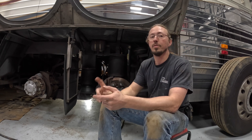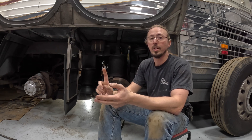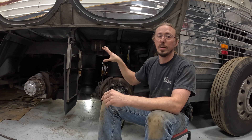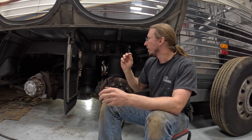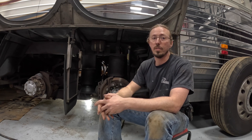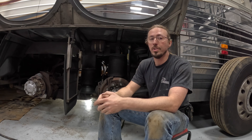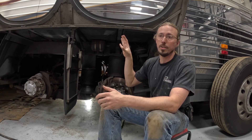You don't want that for a couple of reasons. First, you don't want that water to take up volume within the tanks, potentially freeze, and cause problems. Water in your air system can get into the various air-driven components and freeze up, which causes issues for truckers and bus drivers during winters. You also don't want water to potentially freeze and break your tanks if you let it get really bad. Additionally, on most vehicles the air compressor is engine-driven, so oil can pass through the compressor into the rest of the air system. That's the other reason why you want to drain your tanks — to get out any potential oil residue, which can also alert you if you need to replace your air compressor.